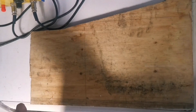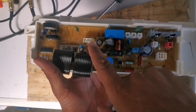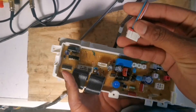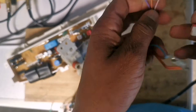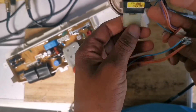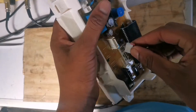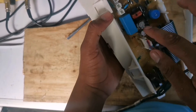Okay, there we go. This is where you're going to connect your pressure switch socket. These are your pressure switch wires — as you can see the color coding is exactly the same as the color coding on the board: purple, orange, and pink here, and pink, orange, and purple here — exactly the same color coding. This is your socket on the PC board, and it goes right here, which means whatever parts need to be fixed are directly behind that socket.